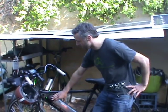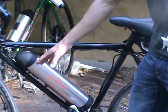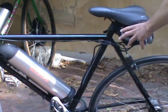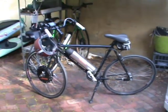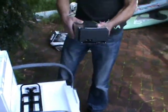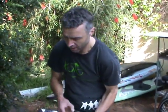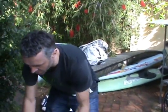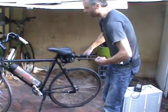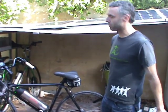This is probably as large as you can get to fit in an average frame. Really, if you're running the 750 watt motor, you'd probably be better off going with the rack battery. This is the other option — it's 48 volt, 10 amp-hours, so you should be able to push it to about 8 amp-hours. It's a lithium iron phosphate battery. For this style system you're probably best with a seat post rack where it locks in. It doesn't perform as well, but you will get your distance and you can probably go a bit further.